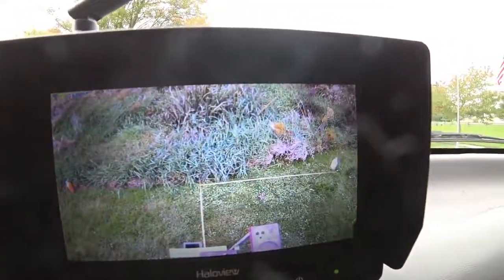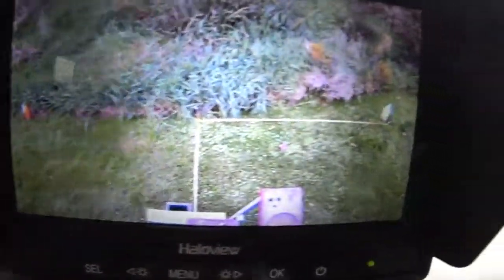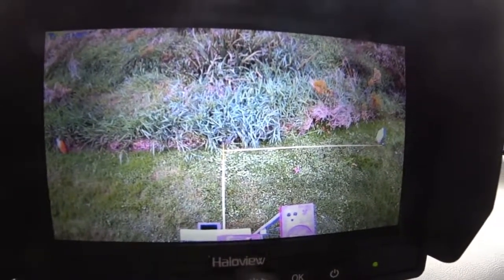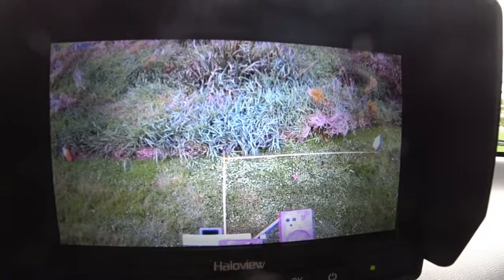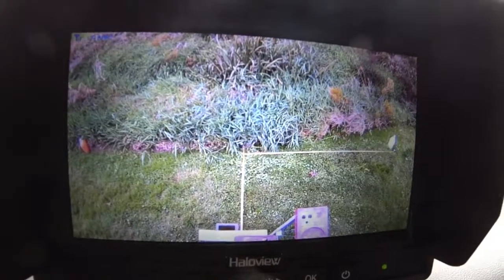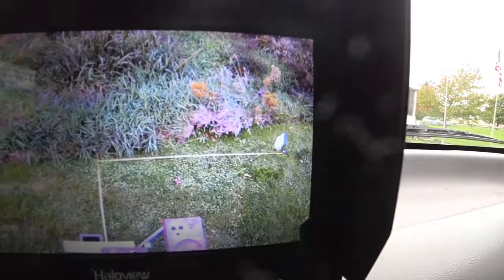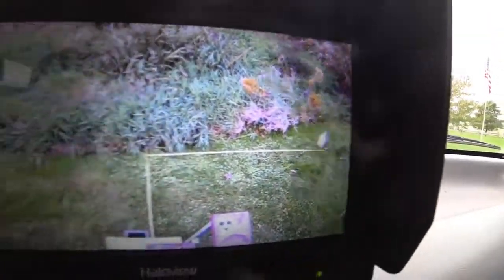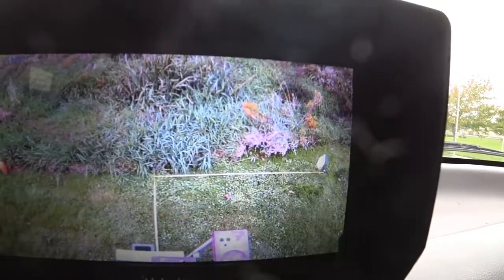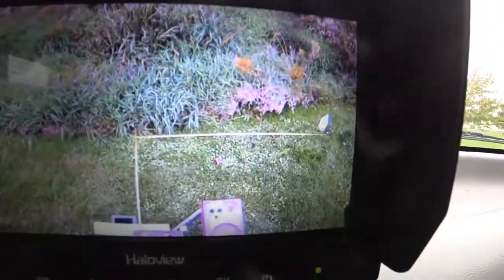So pretty good range. Now I'm going to move those jugs forward, come up about 4 foot, and we're going to see how wide the camera's angle is at that point. Again, this is helping for passing. As I'm driving down the road on the highway and I decide I'm passing around a slow vehicle, once I see the car, which is represented by this jug, on the edge of my screen, I am 7 foot past him, and he is 9 feet away from the center of the RV, or just a couple of feet from the edges.